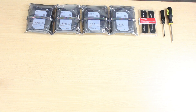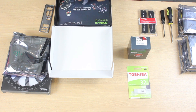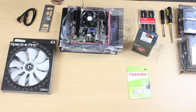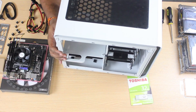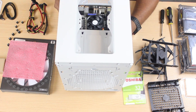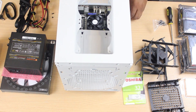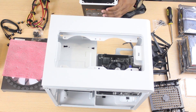The build is pretty straightforward. I pulled out the 5.25-inch drive bay since I wasn't going to use it, and while the case was open I flipped the drive bays around so all the cables were on the left side. This let me seat the GPU without having to pull the drives out. The GPU wouldn't be necessary at all if I had bought an APU like the A8-7600 or gone the Intel route with something like the Pentium G4400.